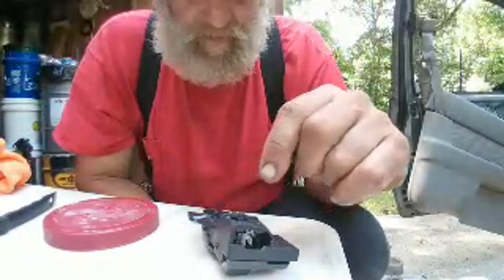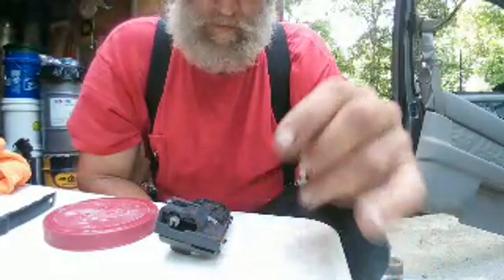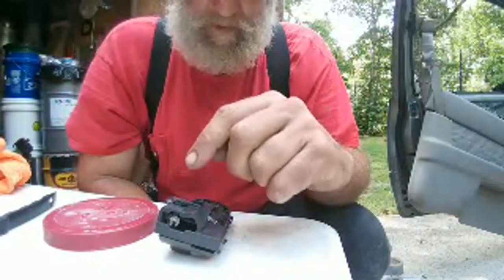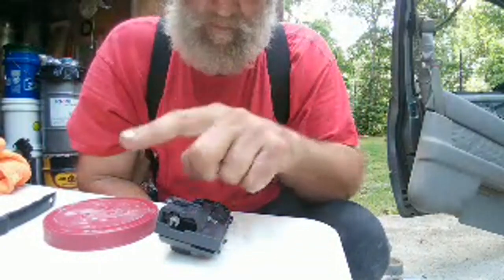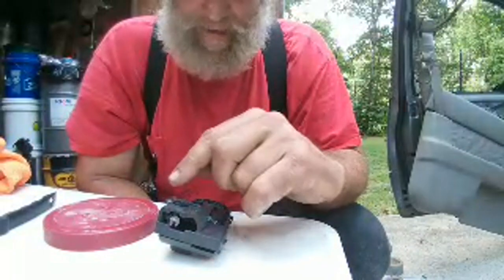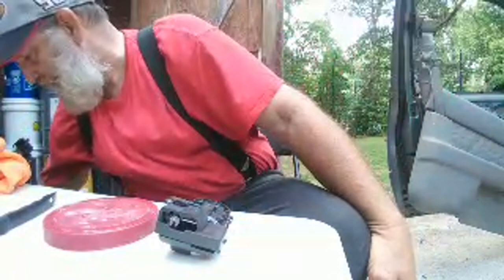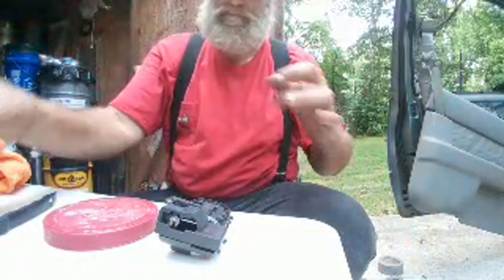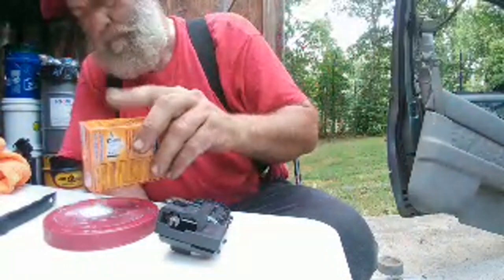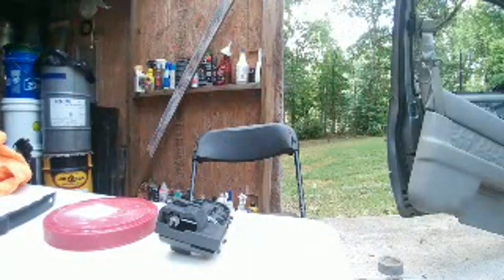And the thing is they have to be done in an order because one lays over the other. And so what we'll do is we'll assemble it with the super glue exclusively, and then I think I'm just going to build the back up with the super glue and the baking soda. And I need to turn the fan because I don't want a face full of baking soda. So let me get me some pliers too.